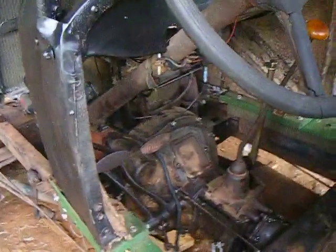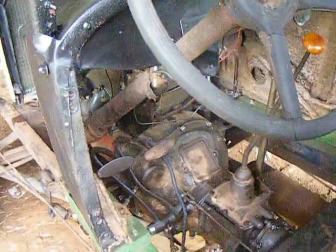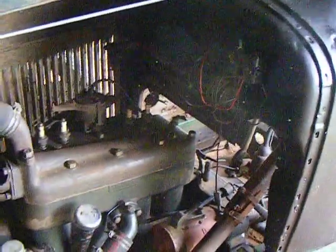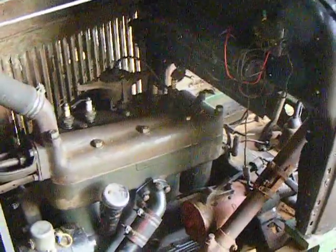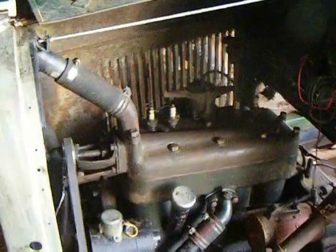I made a few improvements over the last thing. I took an old battery cable off of a Model T frame and I'm using that as a ground, to bring the ground up from the battery to the bell housing. And that seems to make starters turn over better, especially with the 6 volts.